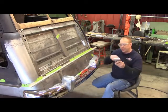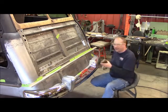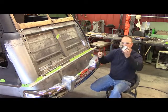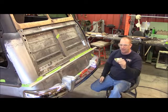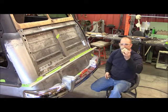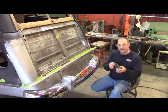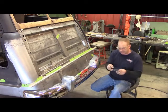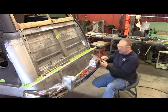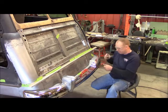So now I went ahead and cut your other one out, because I know it's got to turn way beyond the amount of clearance I had, and I'm fixing to put it on there. And then I run into the one coarse threaded nut that they had put on, I guess, at the chrome shop. So every nut in here is fine thread, and they weld on that one coarse thread, and I'm already here, so I'm just going to go ahead and cut it out and then weld in this nice nut in there, and that's going to allow me to line it. So I'll be able to jig it all up, put the nut in there, tighten it up, and then weld in the new one in the exact angle it needs to be threaded in.